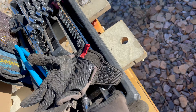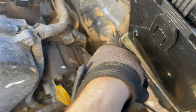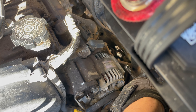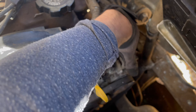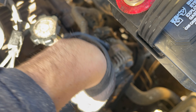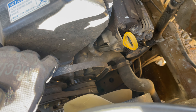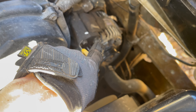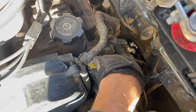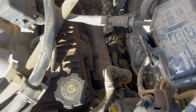I ended up using one of these because this wire housing doesn't give enough space for the socket head — this fits much better on that bolt down there. As you loosen it, this alternator has play and kind of swings down, so you can pull tension and pull the belt. I did pull the nut from the 12-millimeter down here. I'm about to pull this — you've got to remove this plastic covering for the wiring, and there's also a clip back there.